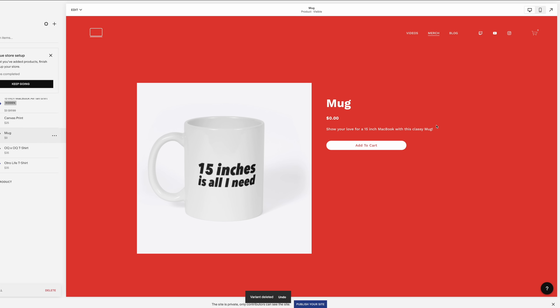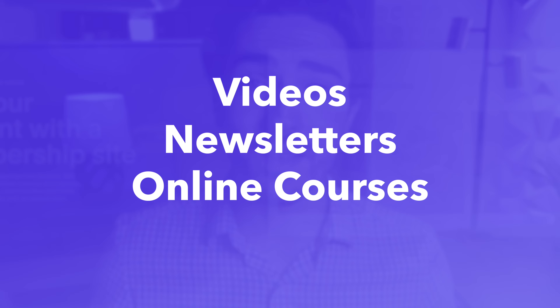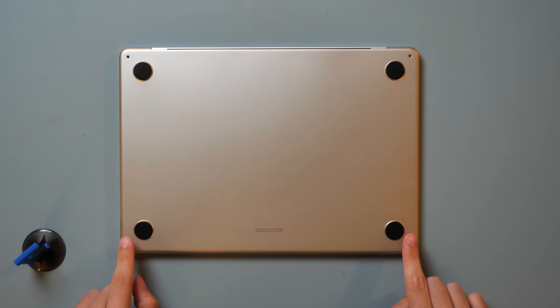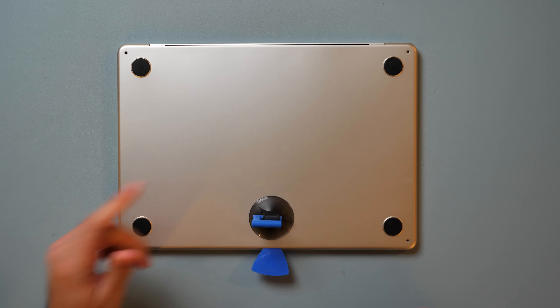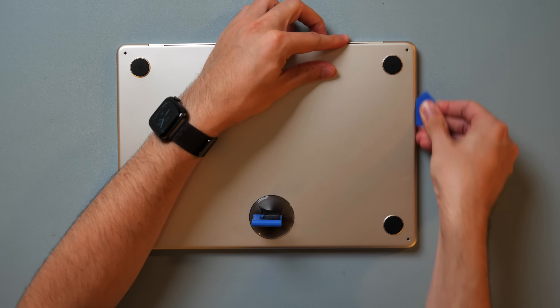Before opening these machines up, I ran a control test on the base MacBook Air. In the first Cinebench run I got the highest score I've tested — 8,405. The palm rest was 41°C and the lower case was 44°C. During the second back-to-back run, the score dropped to 8,030, palm rest rose to 44°C, and CPU peaked at 108°C. In run three, the score decreased to 7,830 and the CPU dropped to 94°C. Finally, in run four, we had a score of 7,618 with the palm rest at 44°C, bottom at 47°C, and CPU at 92°C. Pretty linear, predictable thermal throttling.